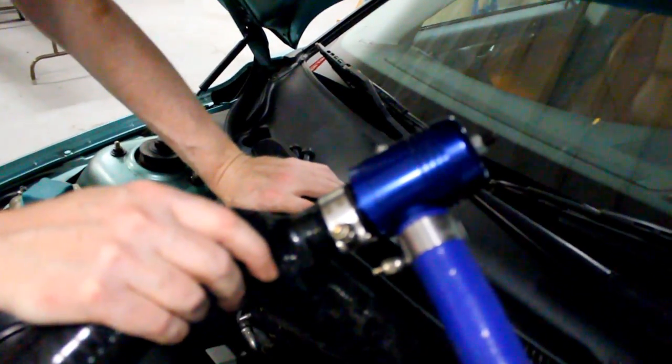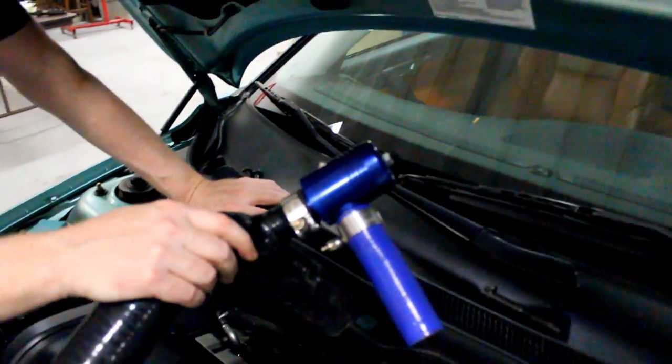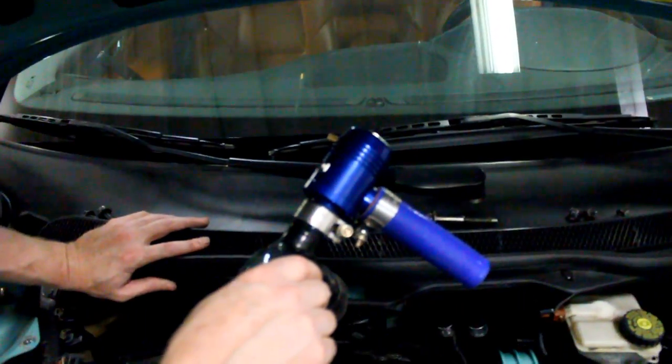This is a prototype, one-off diverter bypass valve that we're testing right now. We know that internal bypasses like the KK24 uses from the factory are not really capable of handling the kind of surge you get at these levels of boost, so we're going to an external valve.